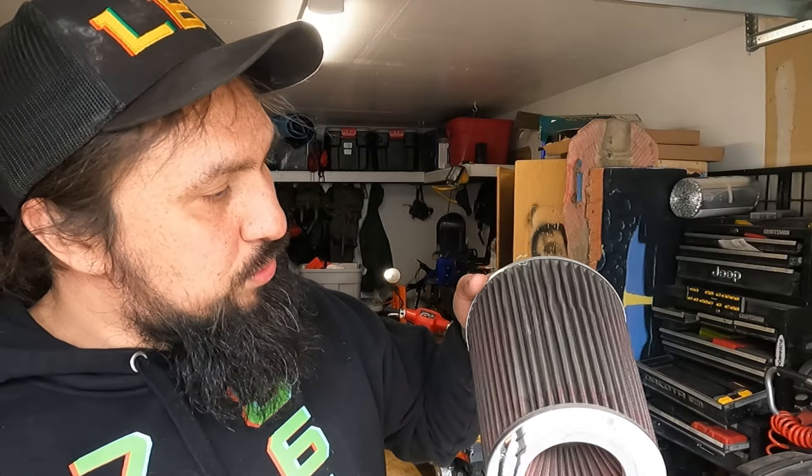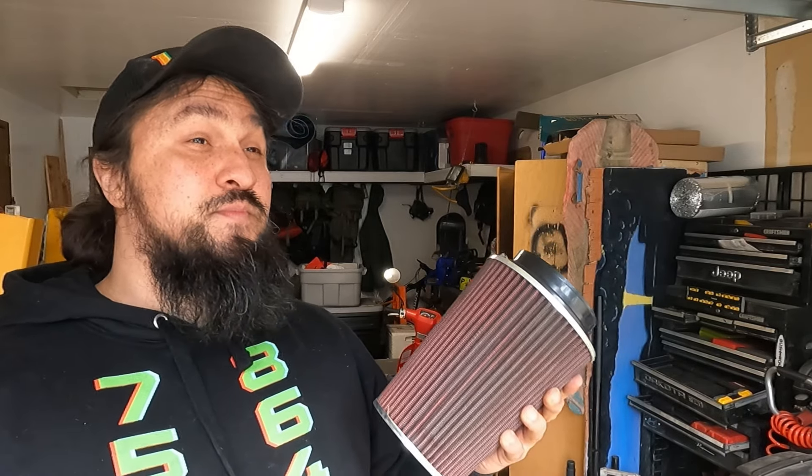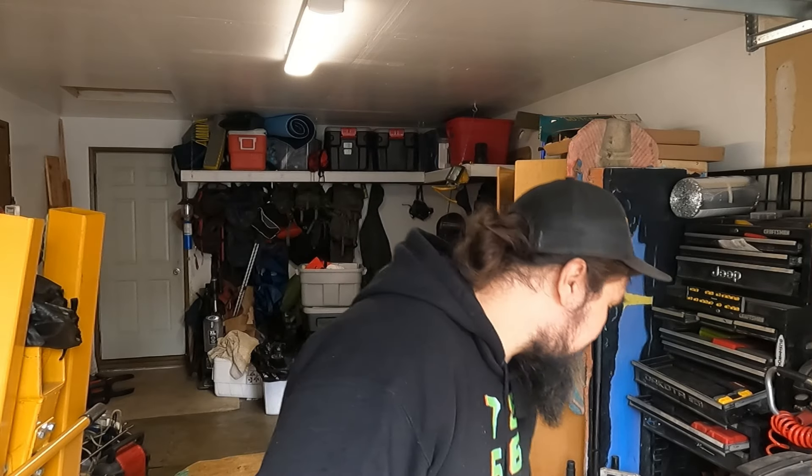This one actually looks pretty good and it's over a year old, so I'm probably going to use it on another truck because that other truck's air filter hasn't been changed in close to 10 years and it looks like crap — this one's in way better shape, especially after the blowout we just did. The signs that you need to change your filter: hard acceleration where you hit the skinny pedal and your engine bogs down, crappy fuel mileage, stuttering or misfires when you accelerate, and for diesel guys — and probably gas too — black smoke, which is just unspent fuel. Hope this helped you out and hope you have a good day. I'll see you in the next one.